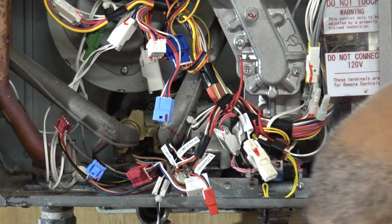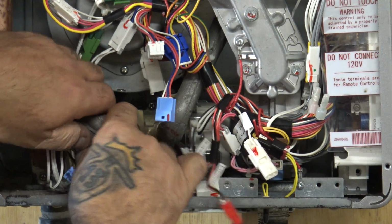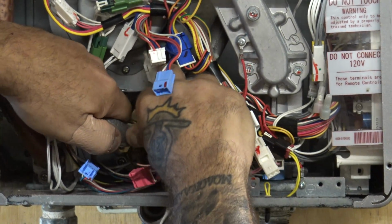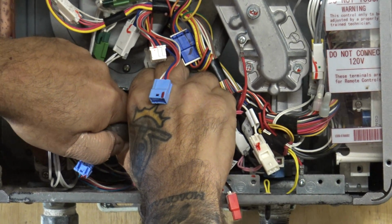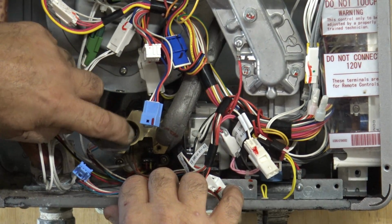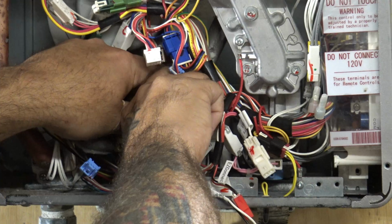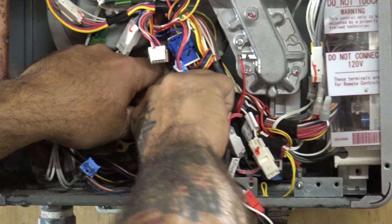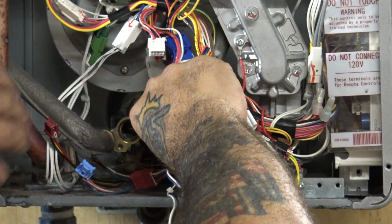I have not found a decent way to do it. Basically, you have to grab it and put your thumb up against this back heat exchanger, I mean the water servo valve, and pull them out. Then you just pull them out of the way. Again, put your thumb up against the water servo valve and wiggle it back and forth and it'll pop out. These happen to pop out easy.